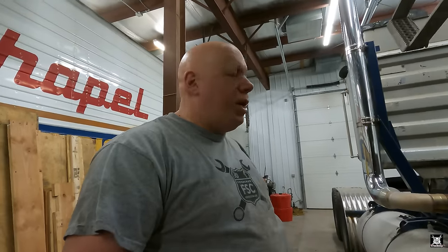We'll get that elbow done, and there's a couple other things I want to check on, plus a basic service, and then we're going to keep on going. So now I'm waiting on the radiator to finish draining because we are going to put all new Caterpillar coolant in it. I want to get all that old crap out and get the new Caterpillar coolant installed.